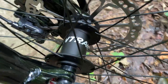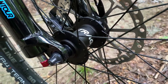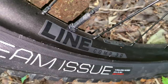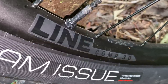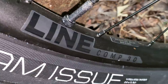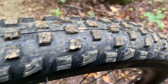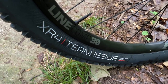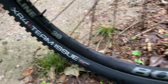Enter the local bike shop manager, who gave me a better option. I had shopped for wheels, but that's also an iffy product these days. What he offered were Bontrager wheels — 30 millimeter, like the factory wheels that came off the bike — the Line Comp 30s. These are the same wheels used on some high-end Trek Fuel mountain bikes. They're tubeless ready, which was important since I was coming from tubeless and wanted to keep things that way. Rather than swapping the Maxxis Minions over, I decided Bontrager on Bontrager works.